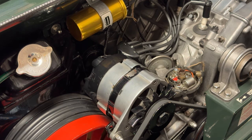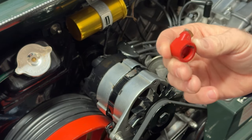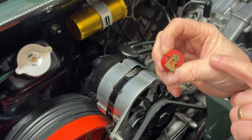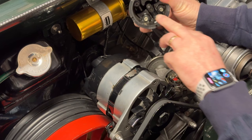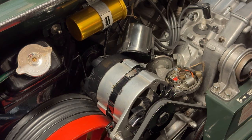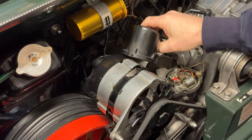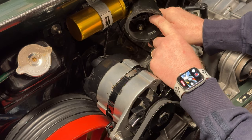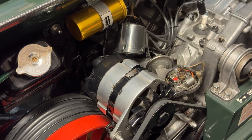This is a red rotor arm — I don't know why, it's just what came with the car. What we need to do is make sure the top's clean so we can get good contact with the little spring-loaded carbon in the top. We'll clean that up and clean the edge up as well. Once the distributor's spinning it goes around and touches each spark plug connection, sending ignition coil spark to each plug, igniting as it comes on the compression stroke.